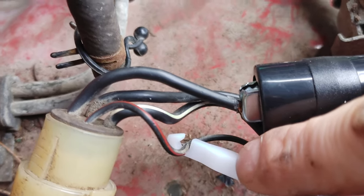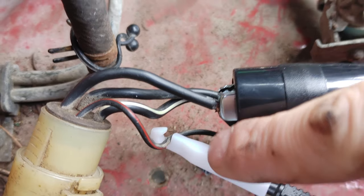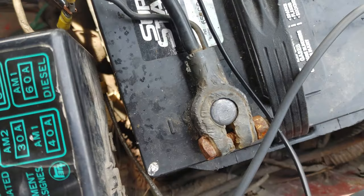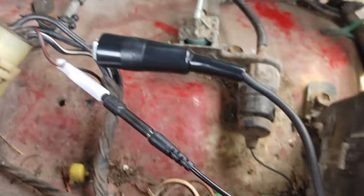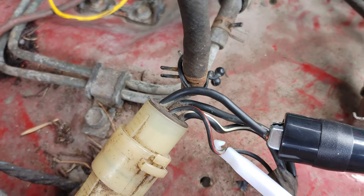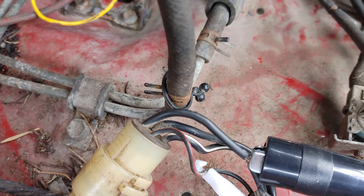But wedging something puts pressure on your clutch, which is not ideal, especially if you're going to spend a lot of time in here messing around — that's just wear and tear on the clutch. So I just used a piercing probe here. These things are pretty cool, they're cheap, and they get the job done. I wired it over to the negative battery terminal — you could go anywhere that's exposed metal in the vehicle to ground.